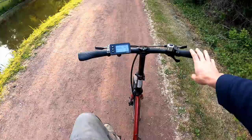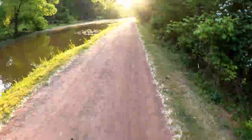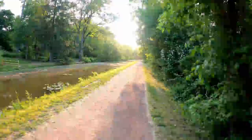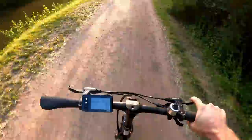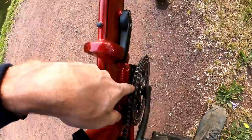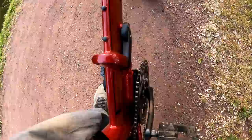We are 2.4 miles in. Here's a quick acceleration test. I'm in the top gear on the shifter right now, which does inhibit how quickly you get going. I start pedaling and I feel the motor just seamlessly kick in — the harder you push on the pedals, the more speed picking up quick. On this range test I'm just rotating, not really putting much power in, but that brought us up to 15 miles an hour. When you downshift, if you're spinning the pedals you can hear it get clicky and cluttery. I recommend downshifting once and then going ahead and rotating again to avoid fighting the motor.